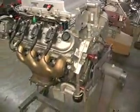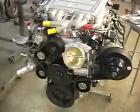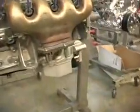So this is really going to be a neat motor. As for the performance industry, it makes 638 horsepower and the torque is 604 lb-ft. So it's really going to have some torque — why do a big block anymore? Notice the oil cooler is built right on. GM has developed a special heavy-duty oil filter that can take the oil pressure that's in this motor.